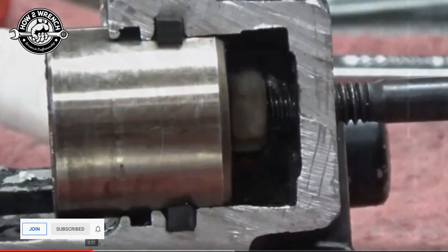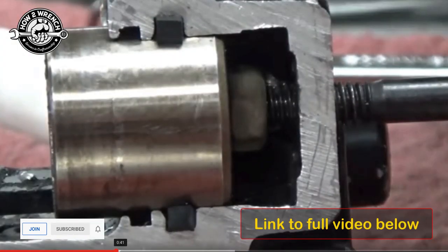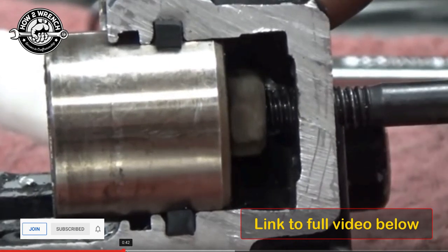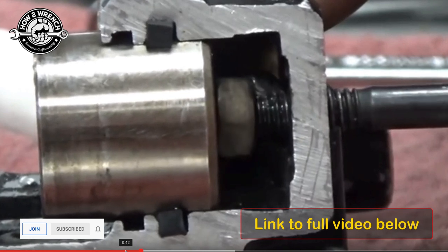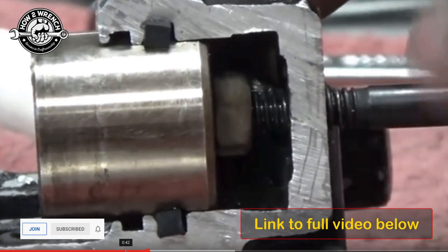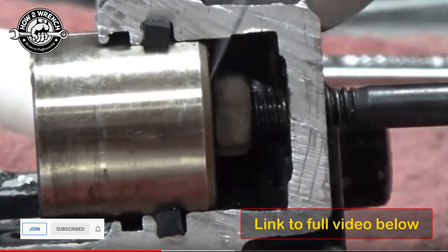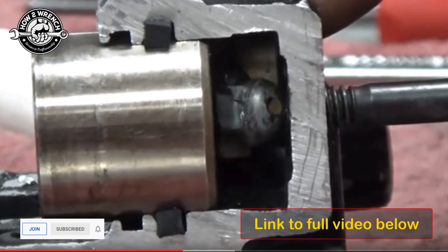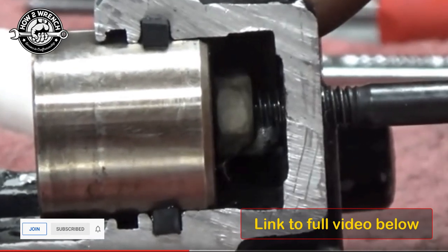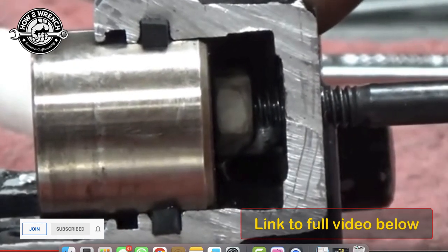I'm going to drop a little clip in the corner — one of my favorite videos ever. Watch what happens when I just move the piston: do you see the bottom of it pulls over? That's you applying the brake — back here is all the brake fluid pushing that out. When you let go of the lever and don't have pressure on there anymore, do you see how the seal wants to relax back to that square position? Awesome.